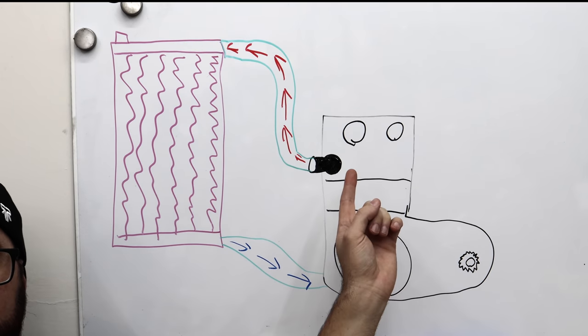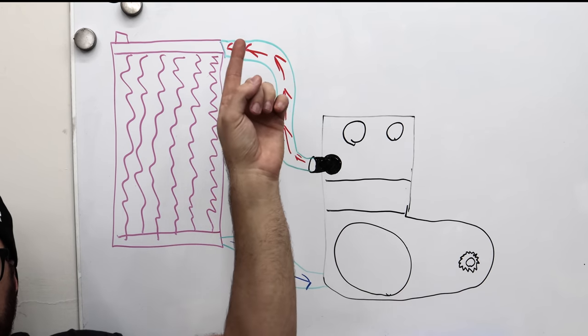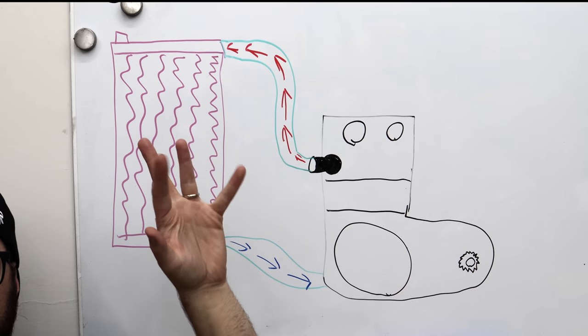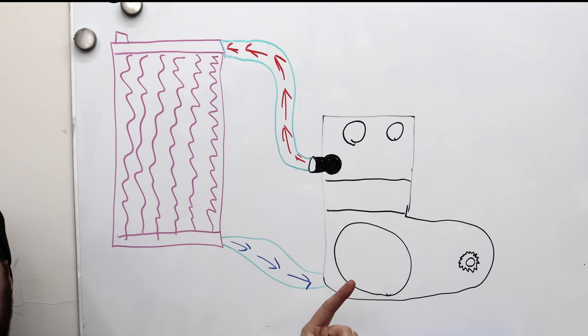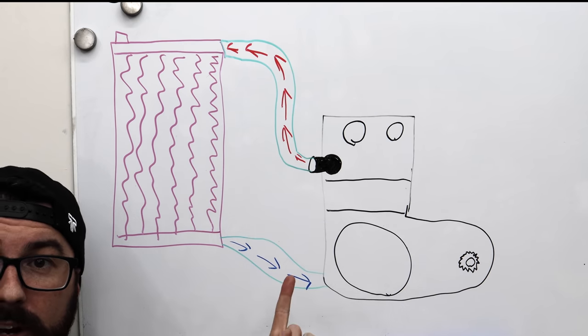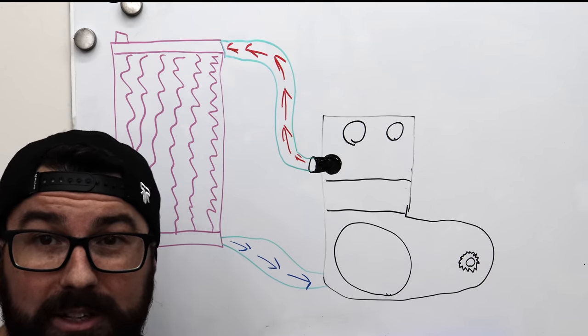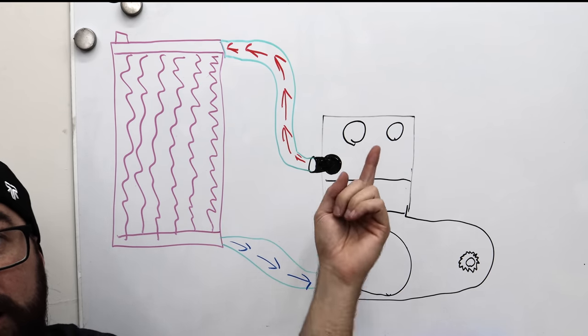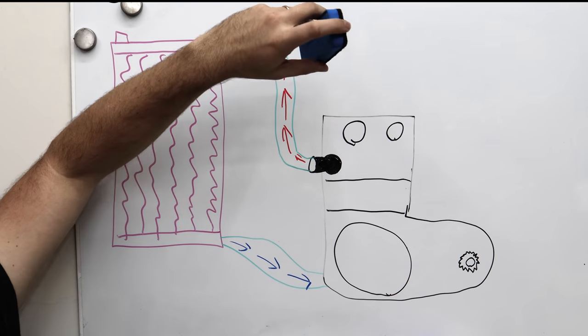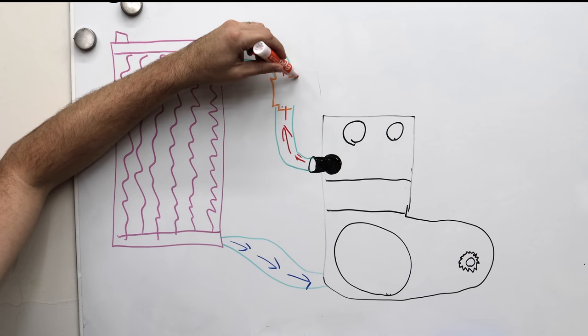Here's an engine. Coming out the top of the head is where all the hot coolant exits. It goes up and through the radiator where it cools off, then comes back in at the bottom on the other side where the water pump is. We need to add this sensor into one of the hoses. We don't want to add it on the cold side after the radiator — we want to know the water temperature at its hottest point, coming off the engine. So we'll take one of the hot pipes and remove a small section to add the sensor.